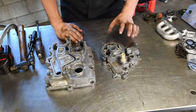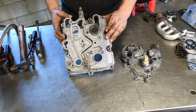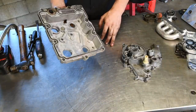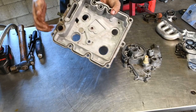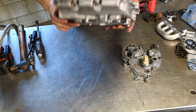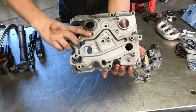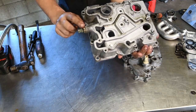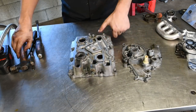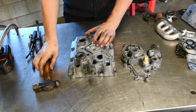That was easy. So this is actually a newer style housing. I had another oil cooler setup kicking around, so I just pre-cleaned it to make this job go a little smoother. This is the piece I was talking about. You can see it has a little hex head on it right there, and on the top, you can see it pokes through. It's the only piece on here that's made out of steel besides this. Well, actually, this is brass, but it's the only piece made out of steel. So if you just take the handle of your hammer and pop it through,